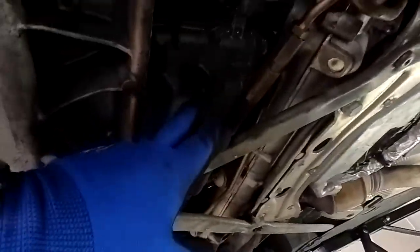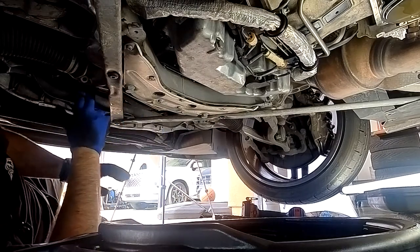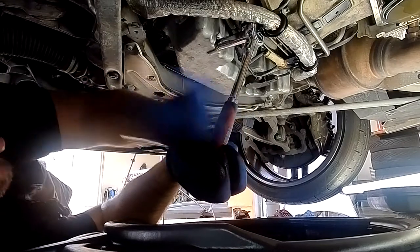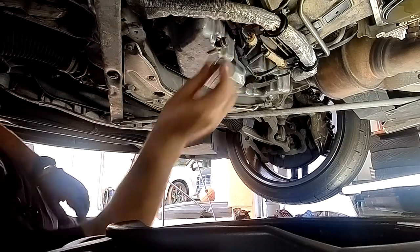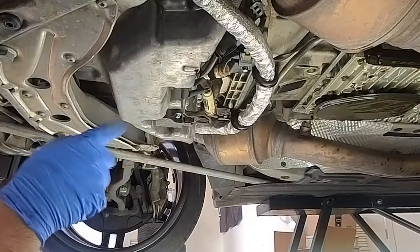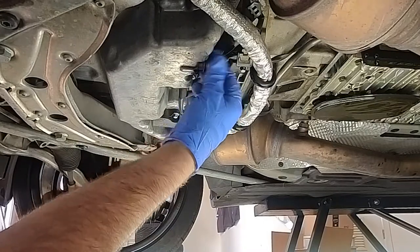This is one of the oil drains for the regular engine oil. The other one's back here. So while I've got this big old mess over here, this is the rearmost drain plug. I'll let that evacuate and then come up to the front most one, which is next to me. Things shot out pretty good. This one's down to a drip, so I'm going to put the new bolt and crush washer in here while I open the other side and empty that out.